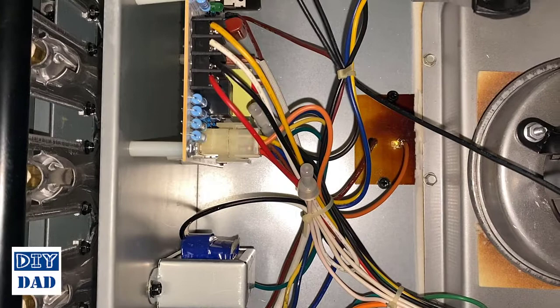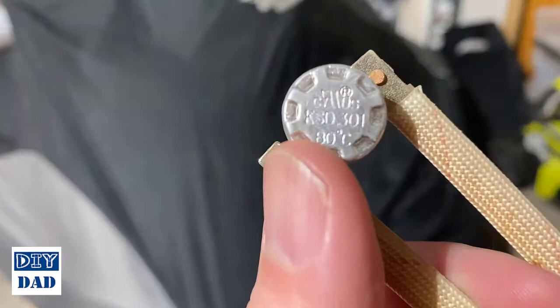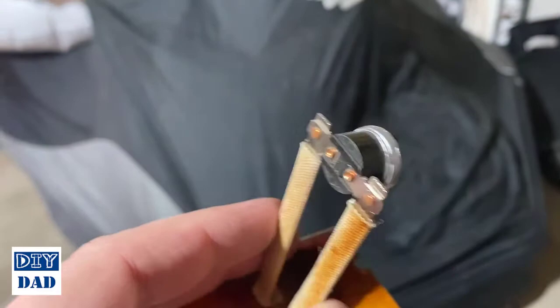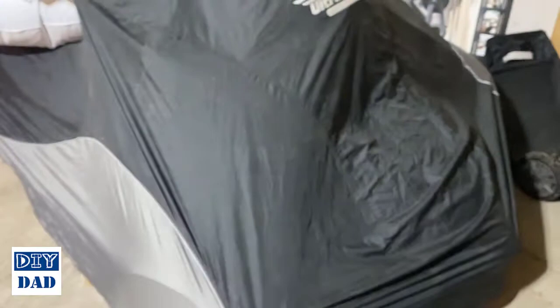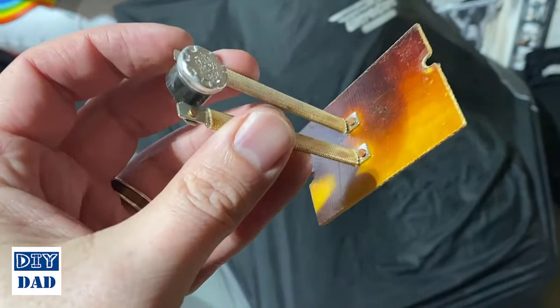All we need to do is pull the wires, pop the screws, and this thing comes straight out. The high limit sensor is a pretty simple device — basically a temperature-operated switch. It has a certain setting where at 80 degrees Celsius it'll flip and stay flipped until temperature falls below the lower threshold. If this is your problem and you're waiting on a replacement part, you can sometimes get it to reconnect by flicking your finger against the top of it — there's a spring on the inside that wears out. Give it a quick tap on the top and that can cause it to drop back into its cold mode.